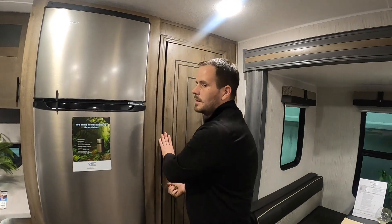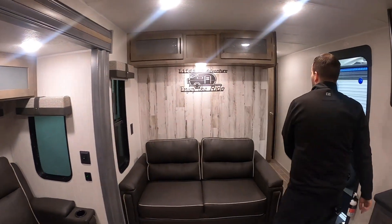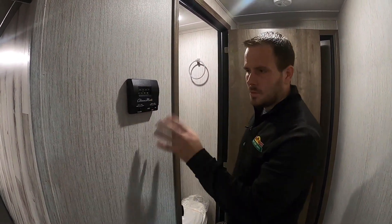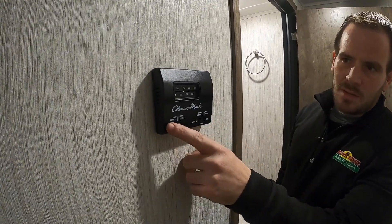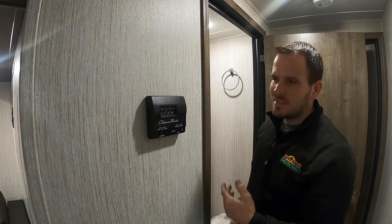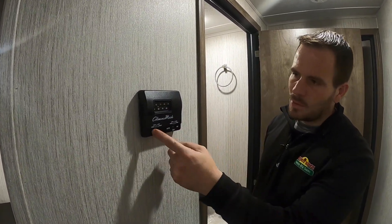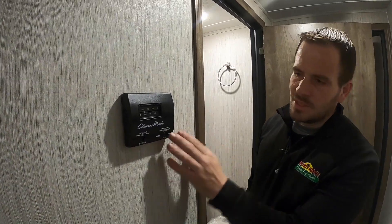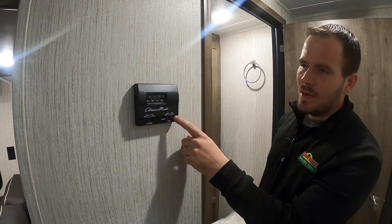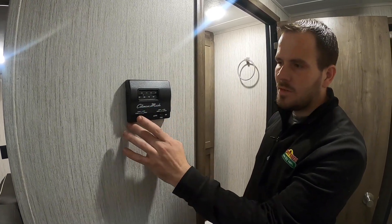Got magnets on the cabinet doors now — nice pantry there. The unit has lights and USB outlets. You have Thomas Payne furniture. Your thermostat — it's a simple Coleman-style thermostat that works really well. You've got your system side and fan side: cool, fan, off, and heat. If you want to run the air conditioner, go to cool. I usually like to leave it on high so it cycles fast enough — if it's really hot and it's on low, sometimes that'll freeze up. Heat's the same way, flip it to heat. The only time you flip to 'on' is if you're using just the fan side. Always make sure you have it on auto when using heat or air conditioning, and on 'on' if you're using just the fan.